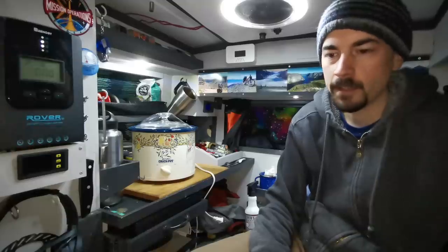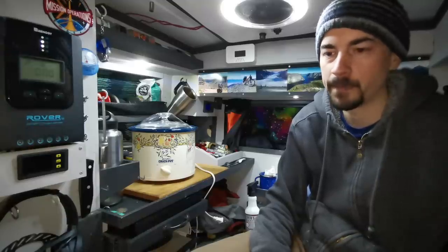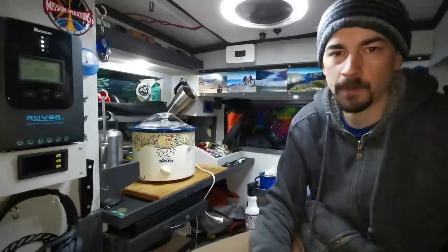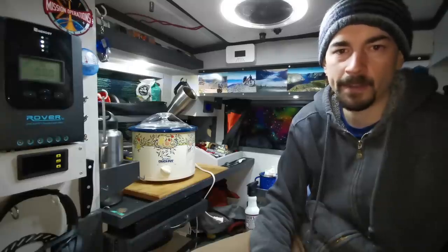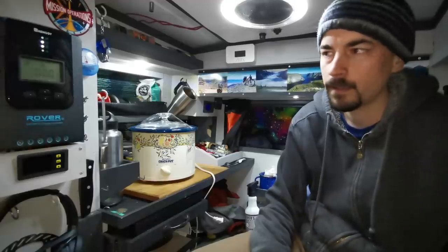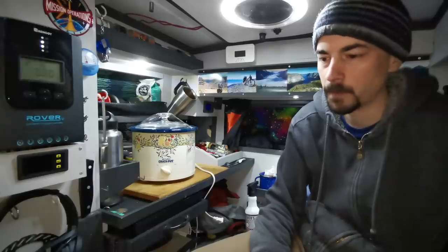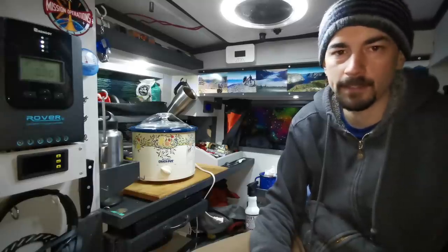The only thing with the 20 amp model, I was a bit underwhelmed with the performance. It just required too much driving around to keep my battery topped up. I use anywhere from 15 to 30 amp hours in a day depending on what I'm doing. But right now my solar isn't providing anything at all — I don't think I'm going to get any use out of that until at least March. So I'm totally dependent on the DC to DC charger.